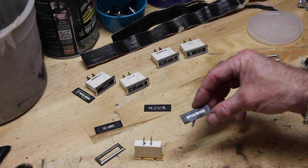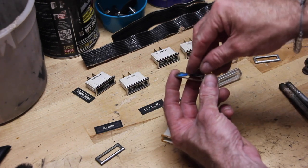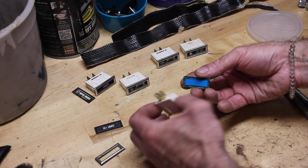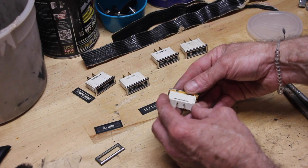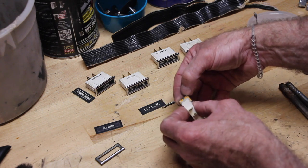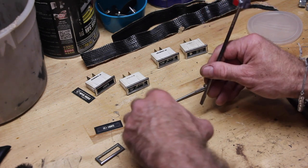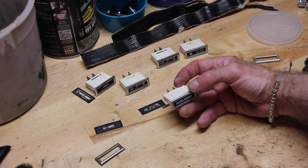Alright, let's put it back together. Grab your newly polished chrome frame. Slide your placard back in underneath the prongs so it sits in there nice and gently. Then take your casing, slide it underneath the two prongs that you did not bend out, slide it into the other side, and then very gently with a screwdriver bend them back into place. Make sure they're nice and tight — check the other side. And there we have our restored dash light.